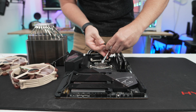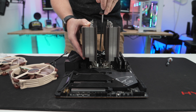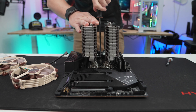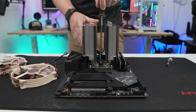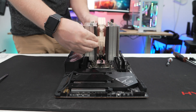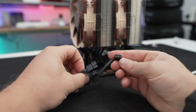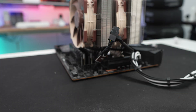Remove the fans from the cooler, apply the included thermal paste, and then carefully place the cooler on top of your CPU, lining up the pegs and the mounting bars with the screws on the cooler itself. Using the included Torx screwdriver, tighten the screws on each side to secure the cooler. Reinstall your fans and connect them to the included Y connector, then plug that into the CPU fan header on your motherboard. You may need to move the front fan up slightly to fit over your memory.